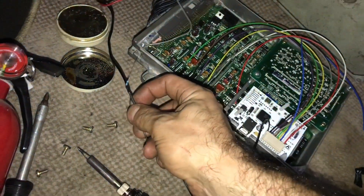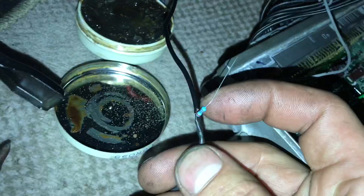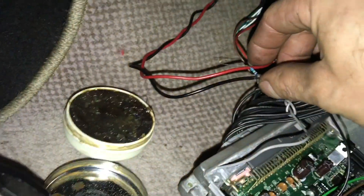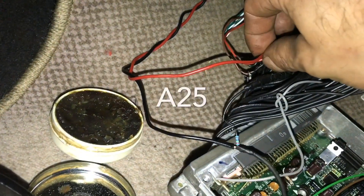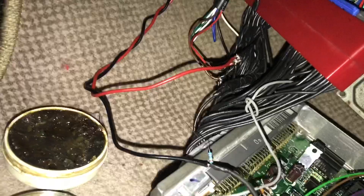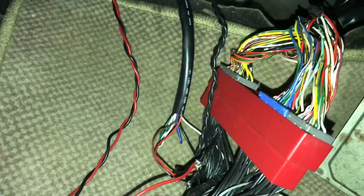You solder your wires together, then take your 2.4K resistor — I thought it was a good idea to put it right in the joint here. Run that between your VCC, which is your power. I stole power right from the ECU where all my other sensors come off of, because it's a decent location and I keep all the stuff inside the car versus trying to find one outside or getting one from the fuse panel.